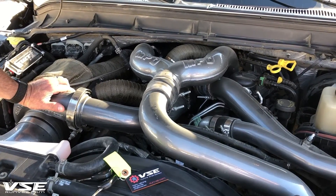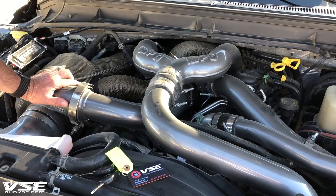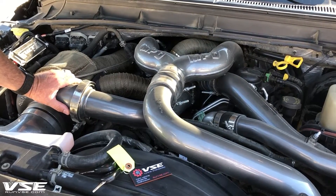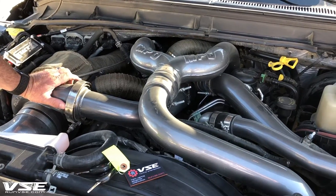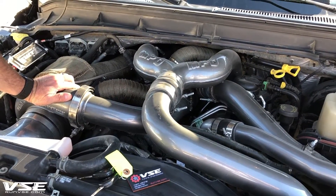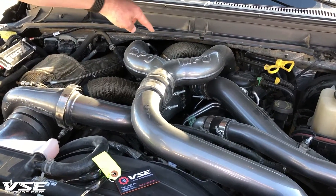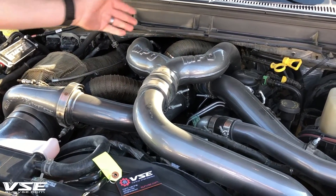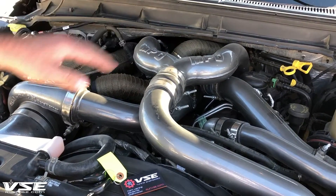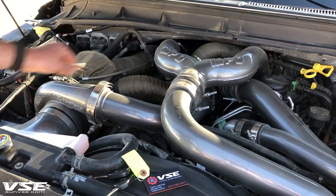Here in Nebraska we're at about 1,100 feet elevation. So if this were stock, the name of the game would be to raise the pressure from 14 pounds absolute pressure — which is zero pounds gauge pressure — to our desired target boost pressure, which varies but is around 28 to 34 PSI. Instead of the one turbocharger having to take the pressure from zero PSIG up to 30-some PSIG, we use this turbo to feed the 2015 turbo.